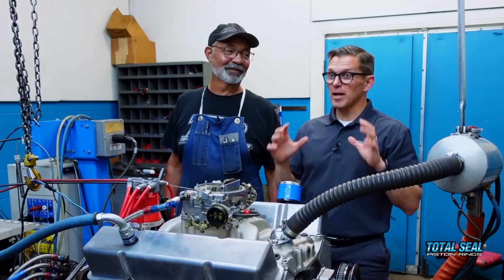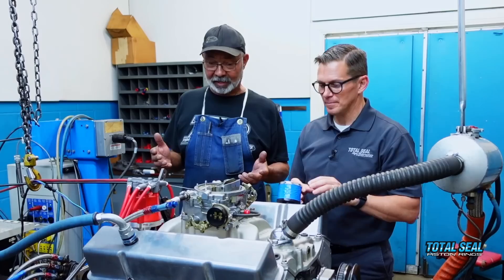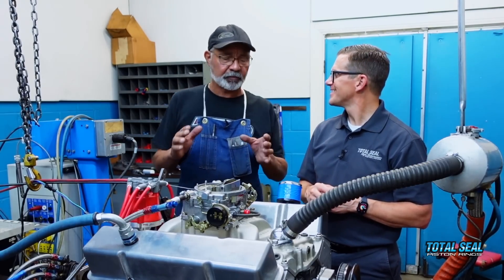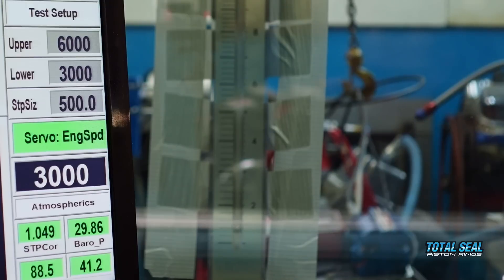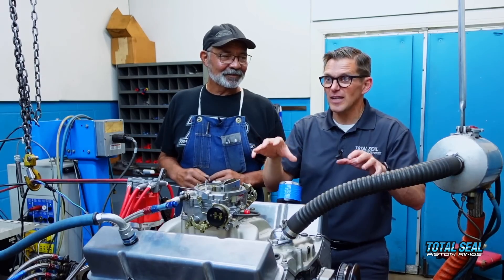Okay Don, that was pretty mind-blowing — we learned a ton today. One of the biggest things that really surprised me: everybody knows when you decrease blow-by in an engine, you're increasing efficiency. I actually had to come in and check a couple times to make sure everything was hooked up correctly, because the blow-by meter was barely working, which means that top ring was really doing its job. In the past when we've run this test on this engine, the blow-by gauge check ball would just bounce away at idle and at 3,000 RPM, then jump up to its spot during a run. This time the thing was just sitting there — it wasn't even bouncing, wasn't even moving until about 3,500 RPM. It was crazy.